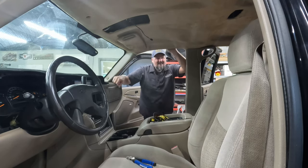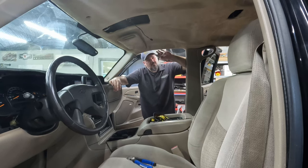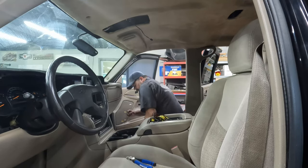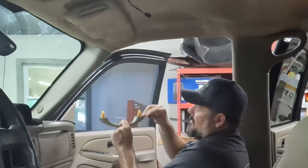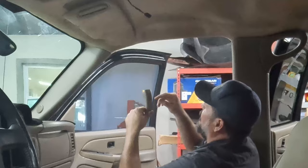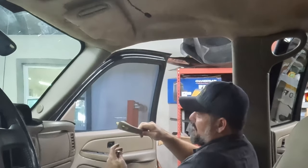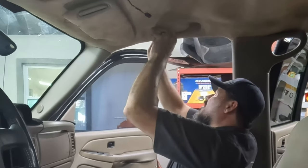I just remembered I put the handle on already. So I think what I'll do is see if I can leave those back plates off and just use the push pins — that just holds the handle to the headliner. As a reminder: this goes into the headliner, these clips go on the back side and click in, and the headliner sits between the clip and the handle. At this point it's not worth it to me to take the headliner back down to do it that way. So I'm just going to stick this in — it goes through the holes on the frame — and then push these pins in and they will clip it in.